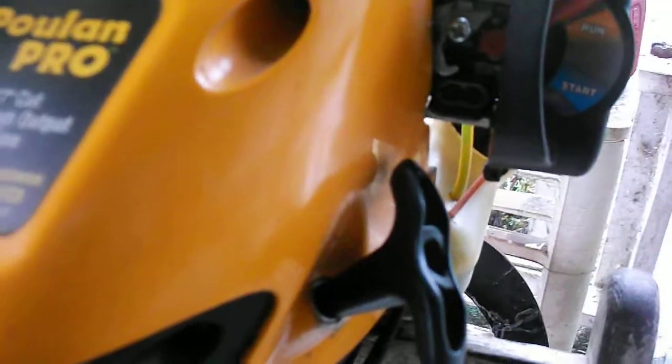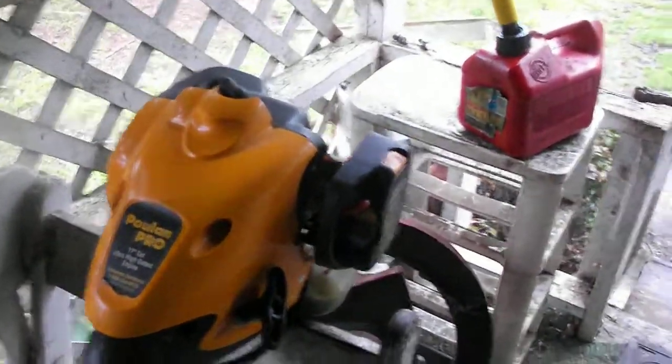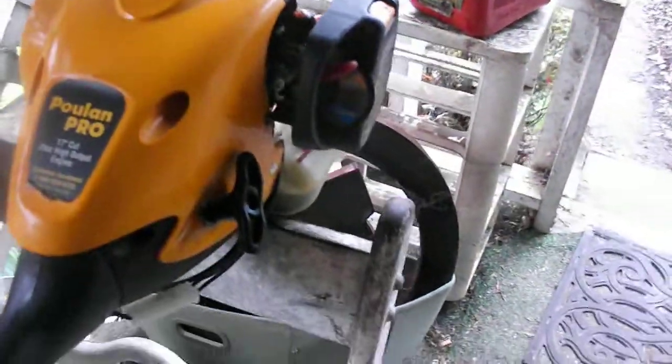The diaphragm pump was fine. That had a plastic cap over it where you couldn't adjust them — the idle and mixture control. Well, I broke that out of there and then I ground two flats in there where I can use it with a flathead screwdriver to adjust it. They come where you couldn't mess with them from the factory.